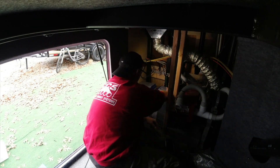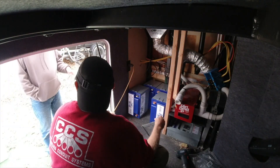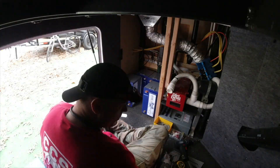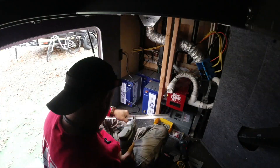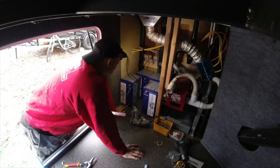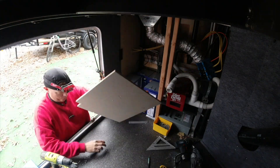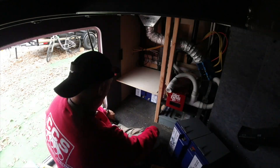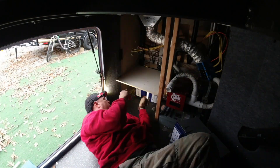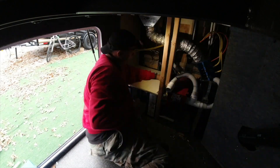I tried a couple of different orientations with the batteries - facing each other, then facing forward. I ended up with a staggered pattern so that it was easy to do the complete wiring. At this point I'm putting in some bracing so that during travel they won't be moving around. I was using aluminum one-inch L-bracket, which you can get at any hardware store. The brackets were arranged on the bottom of the shelf so the batteries wouldn't move forward, backwards, or side to side. They also had a shelf on top so they wouldn't bounce around too much. Getting everything lined up perfectly was a little challenging.